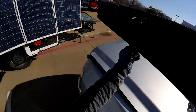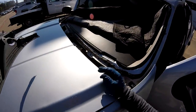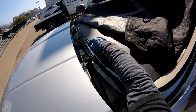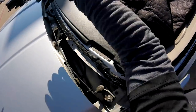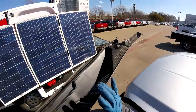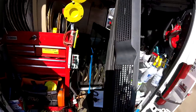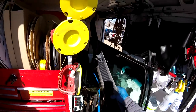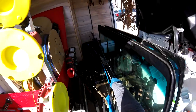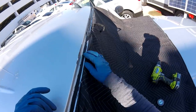And the other problem is it's going to have a gap here, and too much water is going to go inside in this area, and it can damage the wiper motor, or it's more water than the drains can handle. That's why the molding is designed to get the water out of the place. But many glassmen don't realize that's going to happen, because maybe they haven't had any callbacks in the last years when they do that. Okay, so maybe we're going to clean it out.